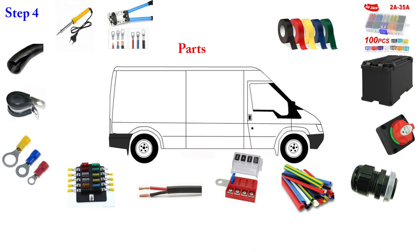A battery box is important — you want your battery in something insulated and non-conductive so no tools or hacksaws can fall onto the battery. Many van fires have started by things dropping onto batteries. I had a van fire caused by an alarm battery shorting out on a coat hanger — it started burning straight away. A box is a must, and you also need to mount the battery securely. Use ratchet straps with good anchors — very flexible and they keep it in tight.